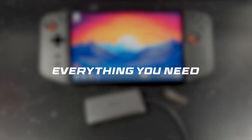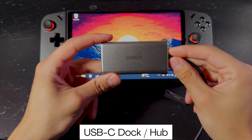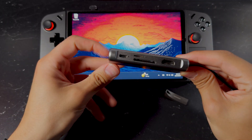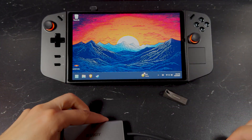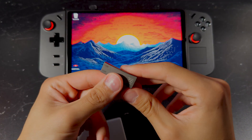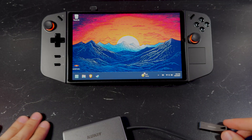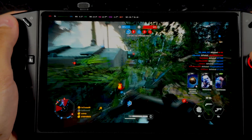To get started, here's what you'll need — I'll have everything linked down in the description below. The first item is a USB-C dock or hub, basically anything that can take regular USB and turn it into a USB Type-C connection. Next is a USB drive with at least 8GB of storage and USB 3.0 or better. You'll also need a laptop or PC to create your bootable image, and of course your handheld. I'm doing this on the Legion Go, but these steps work for other devices too.